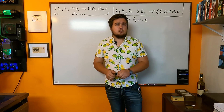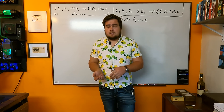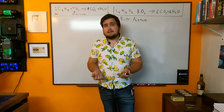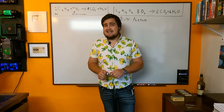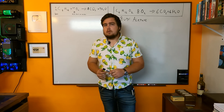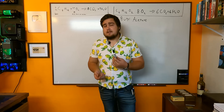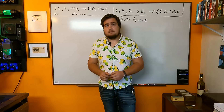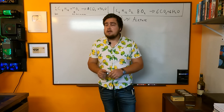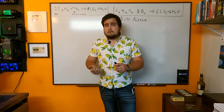Interestingly, N-butyl acetate has a cool flame temperature of about 225 degrees Celsius, which is very, very cold. If we can create an engine that runs cool enough — dropping NOx levels a lot — and still runs on a similar production of energy to mass, then we can go into the second part of my idea, which is plastic pistons. Because if we can create an engine that burns cold enough that we can use polymers and plastics as a piston, then the manufacturing cost of engines goes significantly further down, making things more efficient and cost-effective. So this is kind of a two-part question: can it burn cold enough, and can we get it to run with a plastic piston and not completely explode?